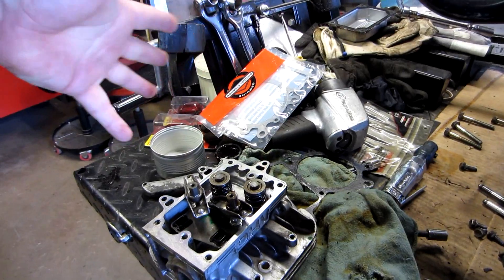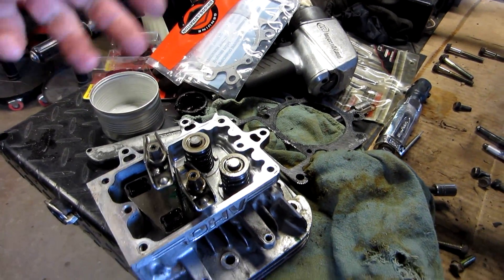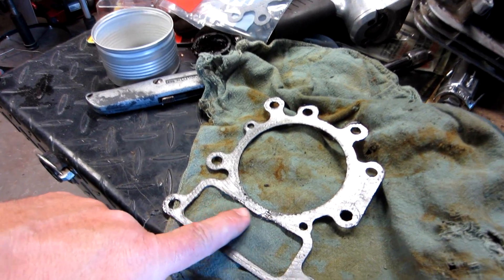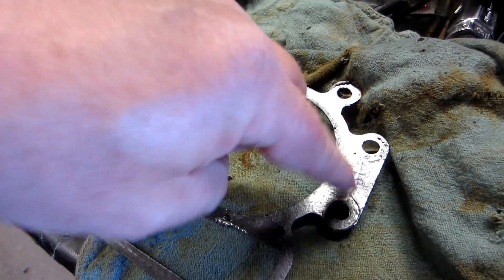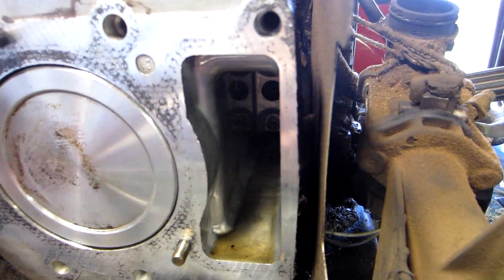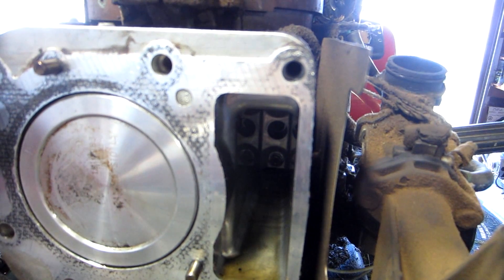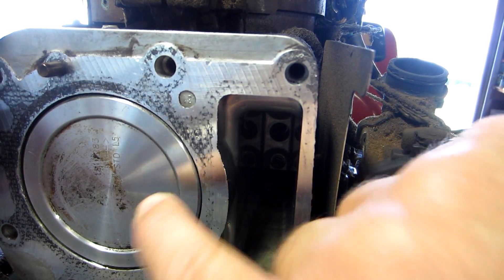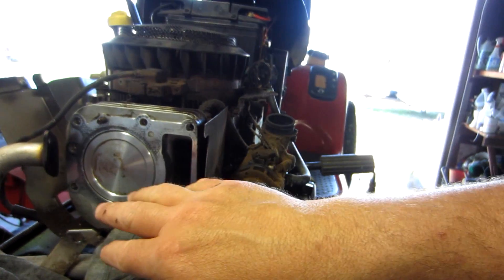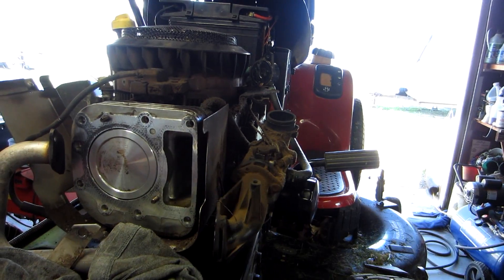If you have that type of setup on your mower, this is going to pretty much pertain to it. When you take the valve cover off — and there are good videos already online showing you how to do this, it's not hard at all, even if you've never done it before you can expect about half an hour the first time — you can see here's the breech in the gasket. It allows the compression in the cylinder to sneak over into this galley area that goes directly into the crankcase. There's the galley area, and what happens is this pressure pressurizes the entire oil crankcase area, which causes blow-by through the rings. So whenever the piston's going up and down, there's pressure on the back side of the engine pushing into the cylinder, and instead of having a nice vacuum in that area, the pressure is making its way into the exhaust.